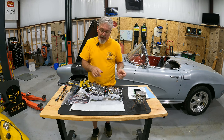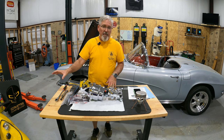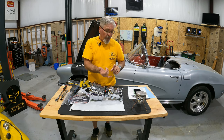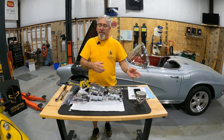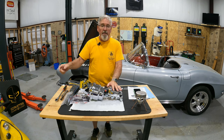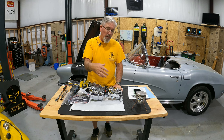So what we're going to do is pull the old one out. I've already gone ahead and put some penetrating oil, penetrating fluid on the three bolts that hold that one in. I haven't messed with the one that's under the dash yet — that should be just a simple pull, the pin comes loose and it'll come out. So we're going to start by taking off the one under the dash, take off the brake line, and then we'll pull these three bolts. The old one should slide out and this one hopefully will slide back in really easy. But before we do the final install, we are going to have to bench bleed the master cylinder, which basically we'll show you as we do it.